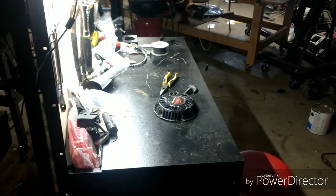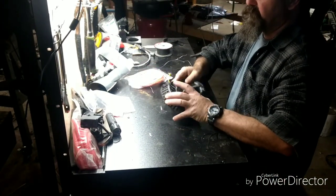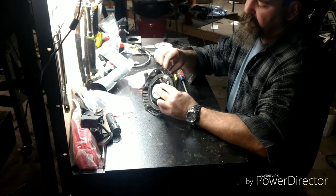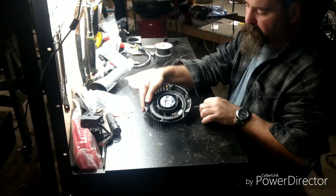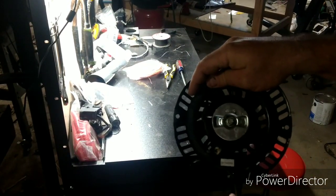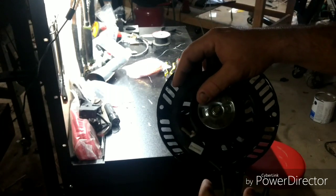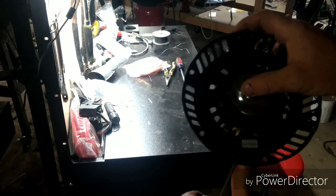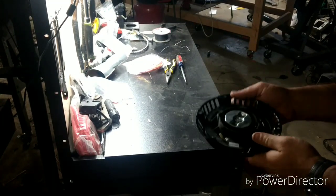Now with this type of Briggs pull cap, they have a lip around here, so instead of running a screwdriver through to lock it I just take a pair of vice grips and clip them on the spool on the outside. Now, when you look inside and pull this rope, you'll see two metal blades come out — that's what engages your starter. When you yank it and it torques, it puts a lot of strain on those tabs, can actually bend them the wrong direction and ruin your cap. You're also putting undue strain on your spring.